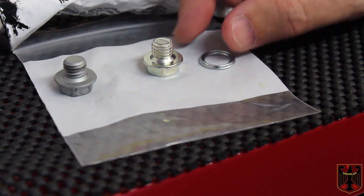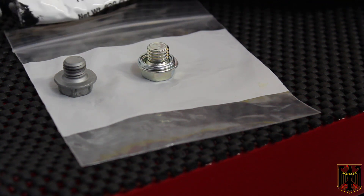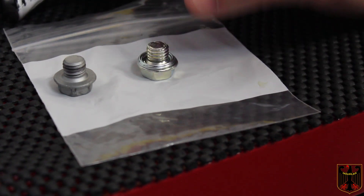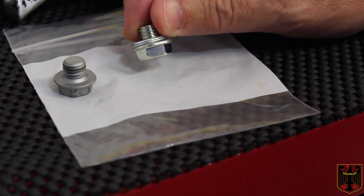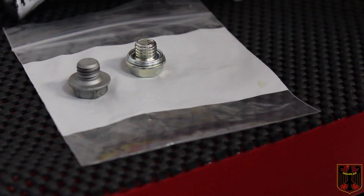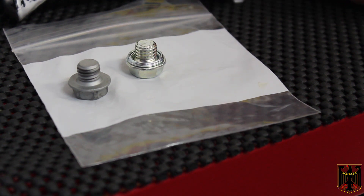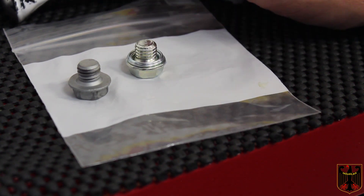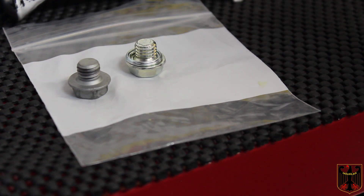So I'm going to put a new drain plug in with a new drain plug gasket — flat side goes down — and then I'm going to use some Toyota seal packing all around here. It's sort of like a high temperature room temperature vulcanized material. I'm inserting this to hopefully get it to tighten up and crush the crush washer, which is only about 10 to 14 foot-pounds of torque — certainly not 35 or 50 like this one obviously was. Hopefully we'll be able to save this drain pan, otherwise we'll have to pull the pan and replace it. I'm going to carefully reinsert it, barely snug by hand, and stop as soon as the crush washer crushes and comes to a stop.